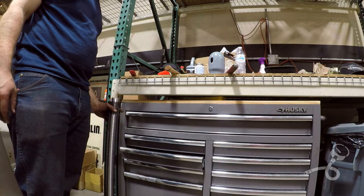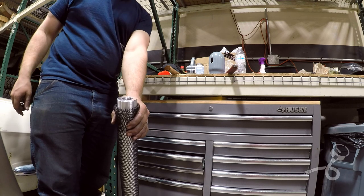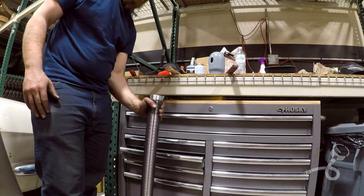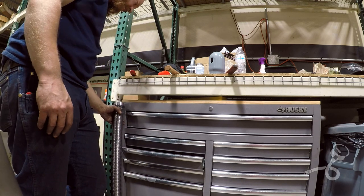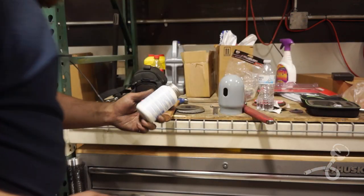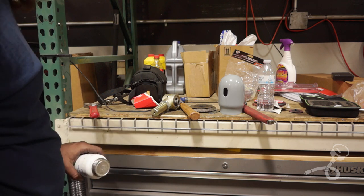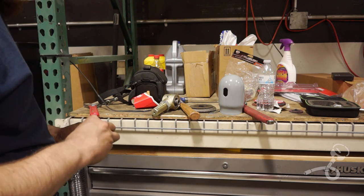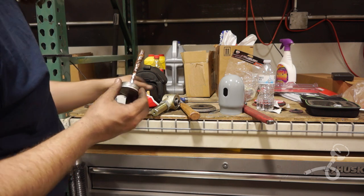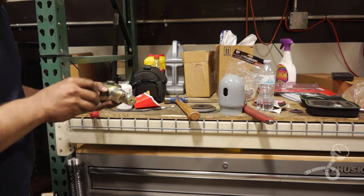One really important detail, super important detail about these links and these really nice aluminum threads in here, is you want to make sure that you use liberal amounts of anti-seize on them, which is why we have this giant tub of copper anti-seize. And I couldn't figure out if copper or aluminum anti-seize was the best choice for these, but in lieu of a response from the internet, we went with copper. So hopefully copper is right.